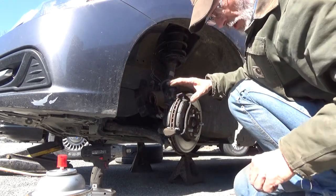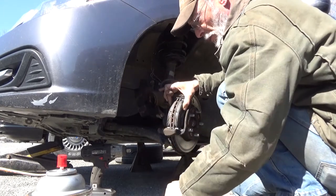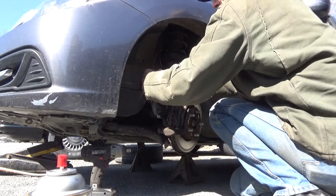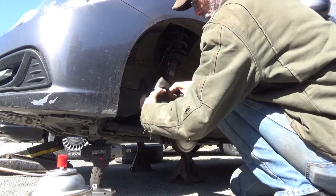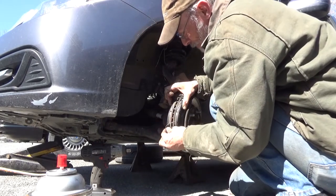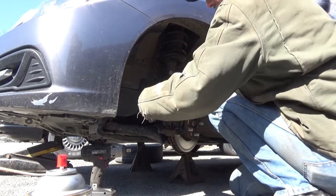Set the brake pad. Where did the little clips go? There's one, there's two. Let's try this again — brake pads in place, clips in the holes, hold the brake pads in place, untie your caliper, get the caliper off the hook, and bring it over. Like I said, these things can be tricky. Pick the clip back up, put it back in again. Make sure you don't have a twist in your brake hose, and slide it over your brake pads.